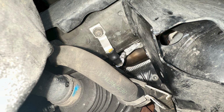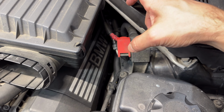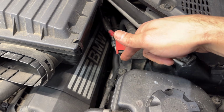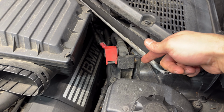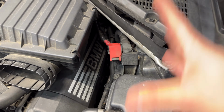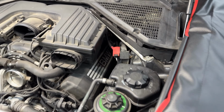because it's a very tight space. You're going to have to release the hose that goes, it's a pressure hose that goes to the back transmission, and then it's just two tens in there, and then the ground strap is two 13 millimeter nuts. The other one is facing up or facing down on the body, but you just remove the panels with 8 millimeters and a couple of clips in there. It's pretty simple. I show pictures of that.